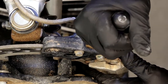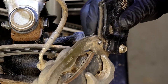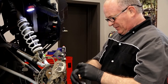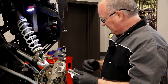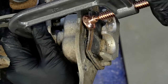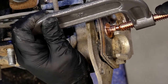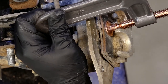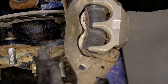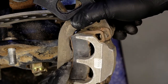Let's open this up just a little bit so we can get it off of there. The easiest way to push the caliper pistons back in is to just use a regular C-clamp. Go dead center. Now we can just walk them out. Make sure this is pushed all the way back — I'm talking about the bracket against the rubber because there's just enough of a gap to walk them out, but not much.